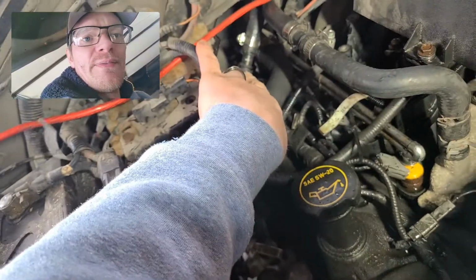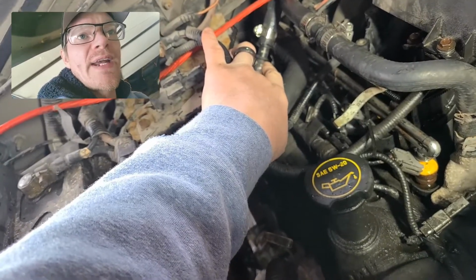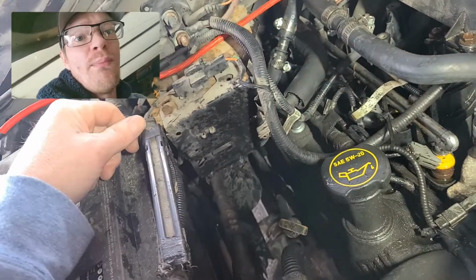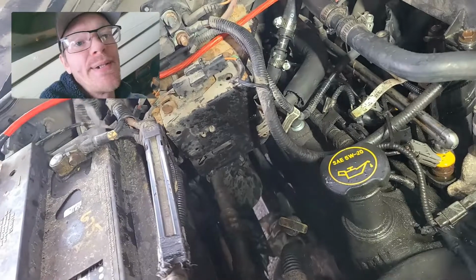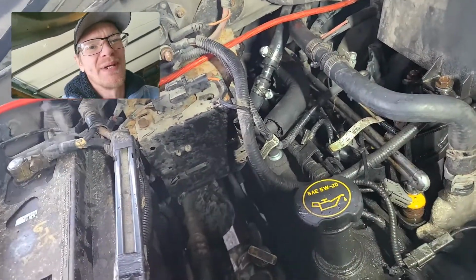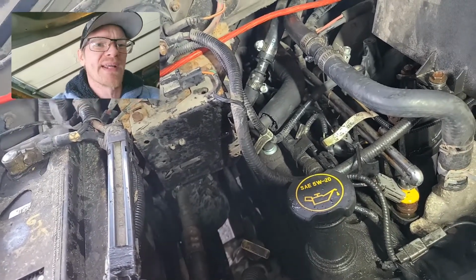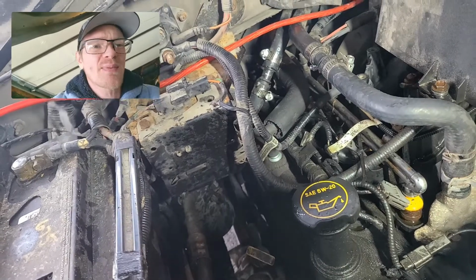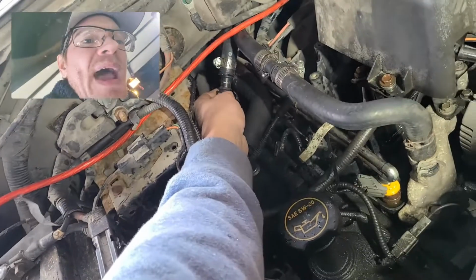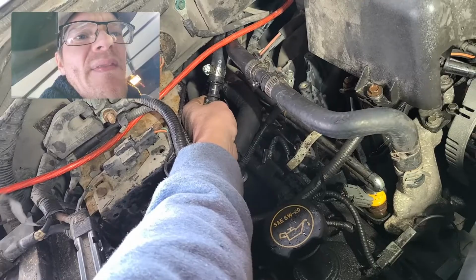Taking this one off, just a trickle coming out. So taking the car off, unplugging this, I put this one on that one and just gave it a blow. Barely got anything. I can get a little bit more flow going through this one, but really bad, and just a trickle of water that came out. So that's probably our issue. We can try to hook up a hose or something to this and back flush it, and maybe get some heat and some life back into that thing.